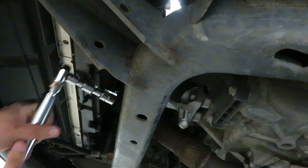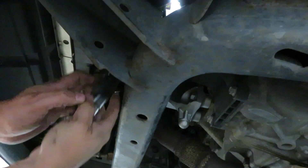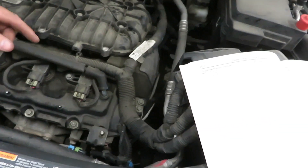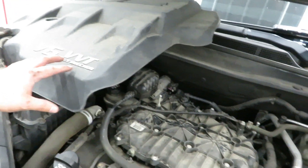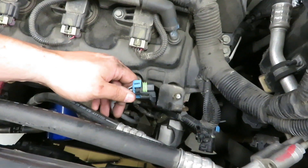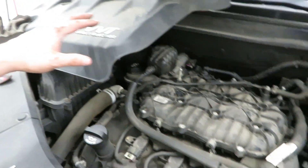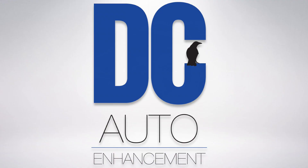This is the top right bolt. In order to get that front mount out, it's going to be easier if you take the engine cover off. I was able to get it up through here — I did unhook the oxygen sensor wire and just wedged it up through there. So that's one thing you'll want to do that I didn't do in the beginning: get this cover off. Now that we have this front engine mount changed, we've got three more, and there will be three more videos on doing that. If this is a project you need to do on your Equinox with the 3.0 — and I believe the 3.0 and the 3.6 are going to be the same, though there's a possibility they're not — this is the 3.0 2011 V6. Thanks for watching. If you have any questions, put them in the comments below. Bye.